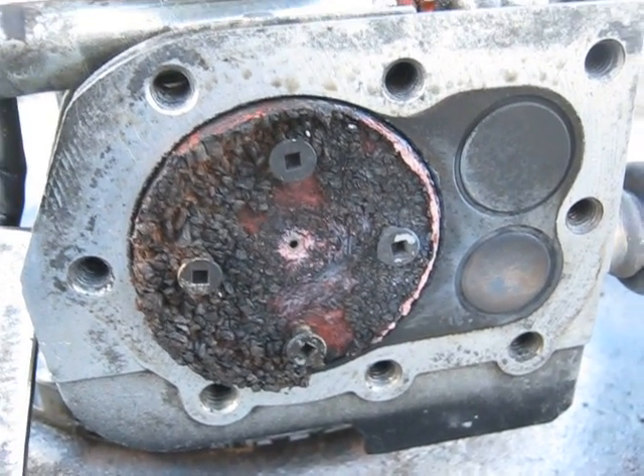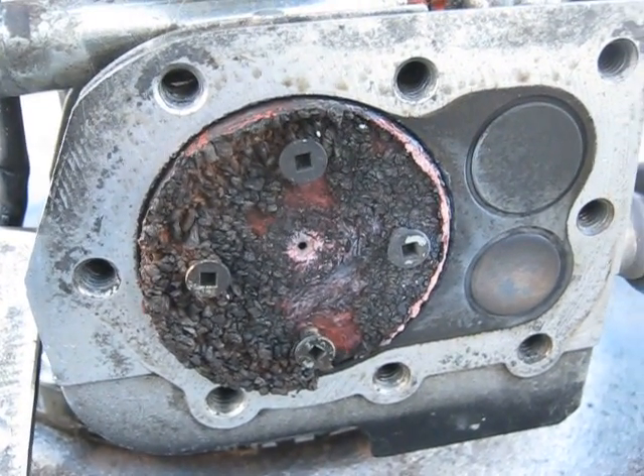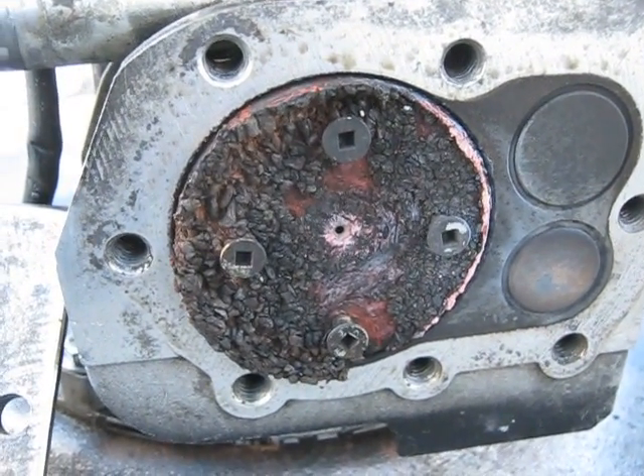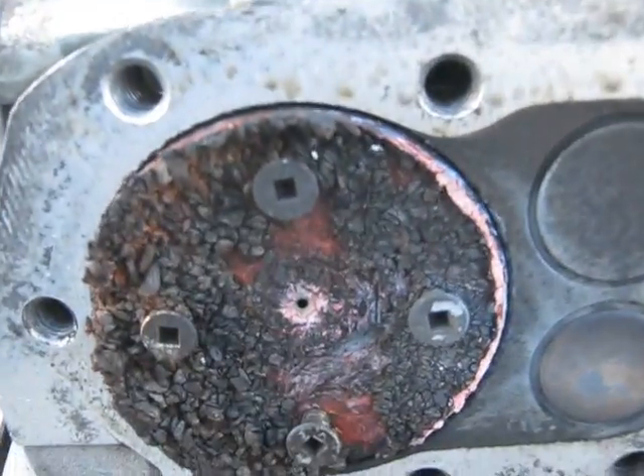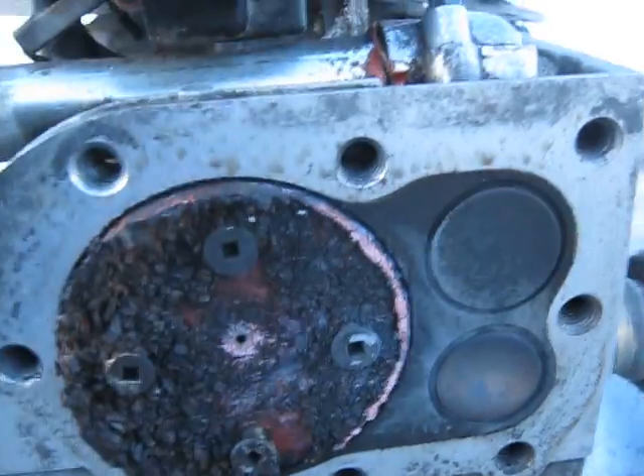It appears I was right. You can see the sixteenth inch hole through the center of the piston there, and the engine was still running. But surprisingly, almost all of the cork's been eaten away — it spit it all out under the snow there.